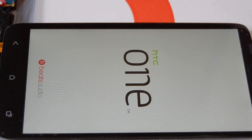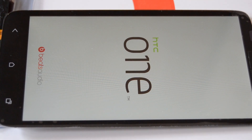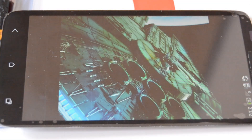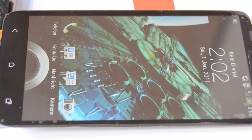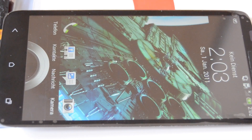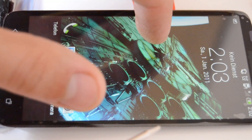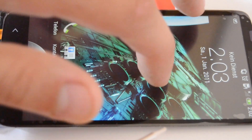This screen only cost 40 dollars, which is really nothing because the original screen costs even more than 130 dollars. The colors look really good and the resolution looks really like the original screen — I think this is not a cheap screen like on some other Chinese smartphones. Here we are in Android and the colors and resolution really look like the original screen. But after I reassembled the whole device, something strange happened: the LCD backlight just stopped working and it did not show anything.